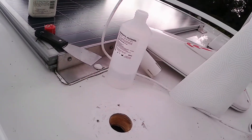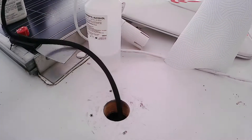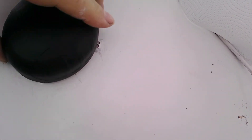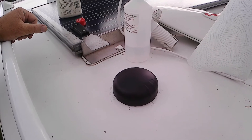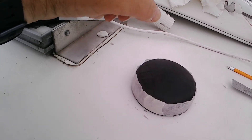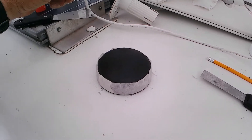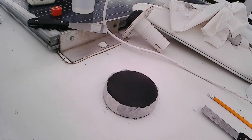Now it's a case of feeding down the Puck. I'll have to fetch it back out - I'm just checking it covers everything. Yeah, brilliant. Once I get it central, it'll cover these screw holes just about. And then a bead of mastic round it will do a brilliant job. I've put a bit of masking tape around, and I'm just going to put a line of Sikaflex round the edges where the old screw holes are just poking out a bit - that'll just make sure it's sealed.